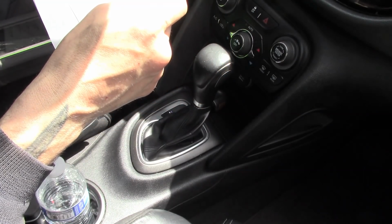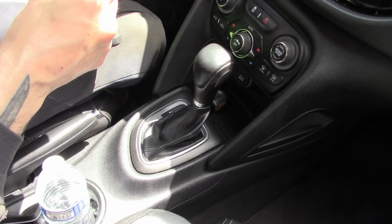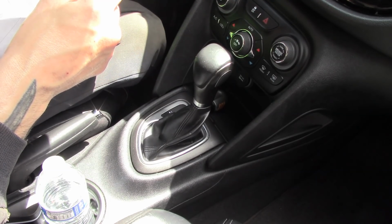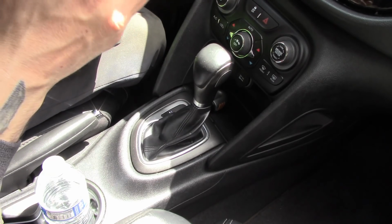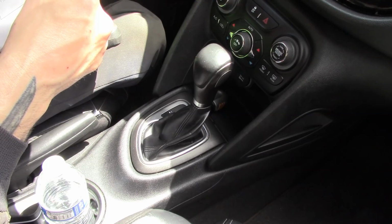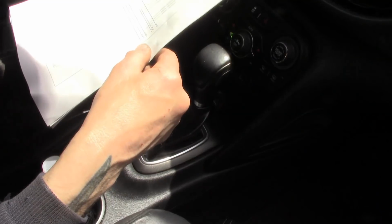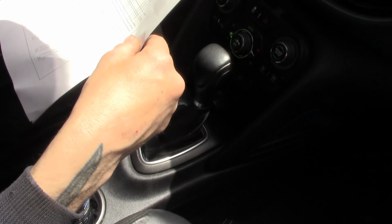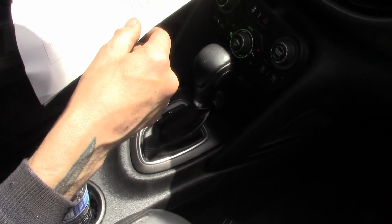Unfortunately, this isn't like the 80s or 90s where when you bolt something onto a car, you really didn't do any damage by putting stuff on. Nowadays, putting an air filter, which this has a cold air intake and some other stuff, you can definitely cause problems. These cars are too sensitive and usually need to be dyno tuned once anything is changed like that. But we're going to see, being that we have circuit codes here, if there is anything related.